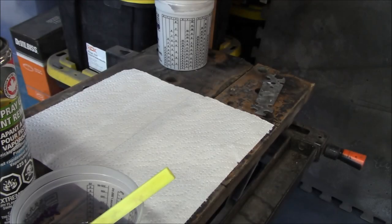If you remember me talking about yesterday, there are possibilities where you may want to clean your gun in between using the same product. For example, yesterday with the polyester primer, where it's got a very short life, I think that had a 35-minute shelf life, and you're needing to mix another batch, it's sometimes a good idea to actually stop, clean your gun out before you do your third coat. So it really depends on the product you're using, but for the most part, I'll be able to spray either a high-build urethane primer, a base coat, or a clear coat, all coats before cleaning the gun at the end. I don't clean between each coat, just at the end of the preparation.